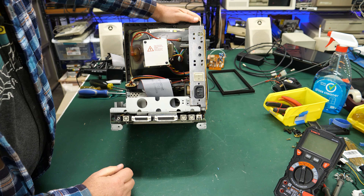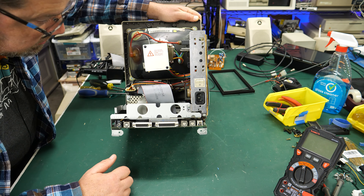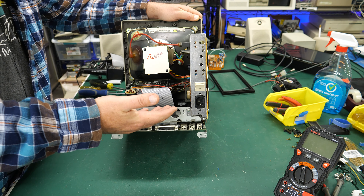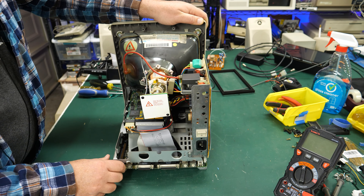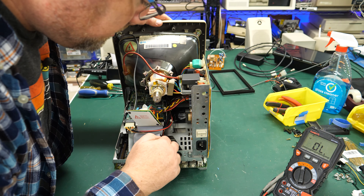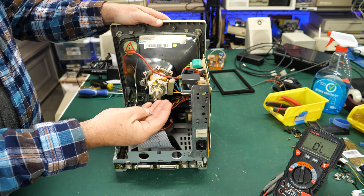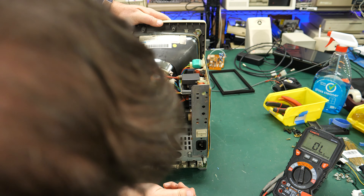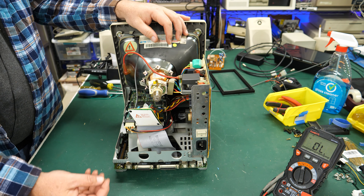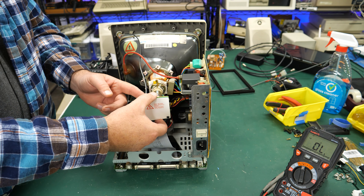There we go. This one has everything connected, including the SCSI drive. It also looks very good — not seeing anything disconnected or problems with it. But there's got to be something, right? Let me just check the fuse on this real quick because I can reach that. Yep, it's got a good fuse. Something just broke off and dropped down in here. Oh no — it's the CRT. The little nipple on the back of the CRT broke. I was just straightening up the neck board, making sure it was straight, and I heard a little crinkle.